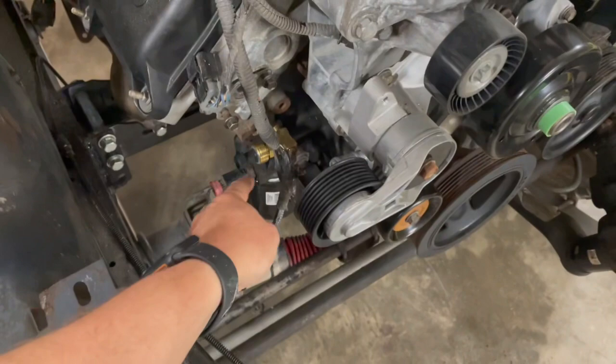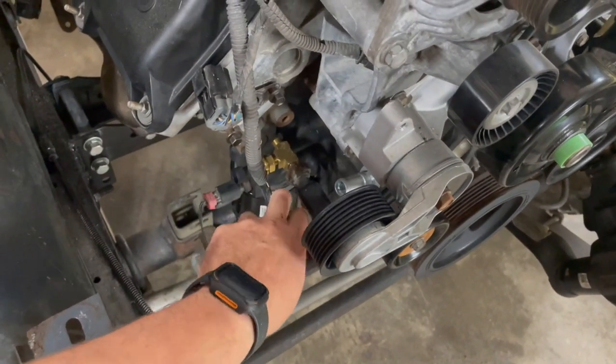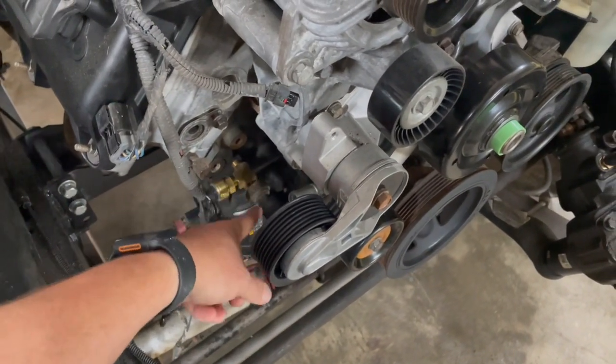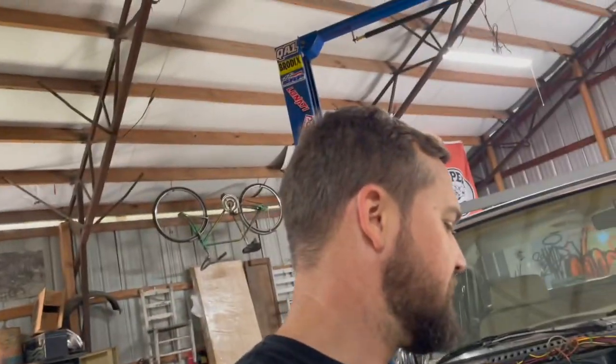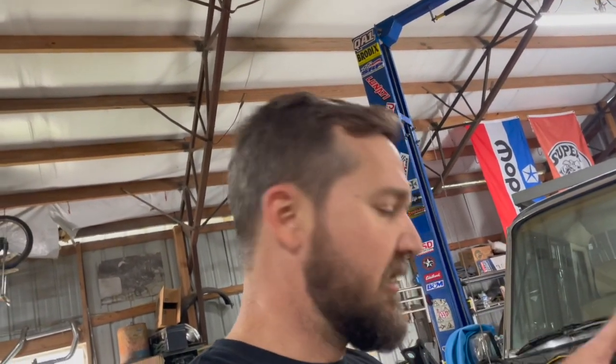So the other day, I didn't film this, but I got my oil pressure for the Dakota Digital mounted, and the factory is still there. We just went and got a 1/8 inch T, and screwed it into where the original one went in, and that way I can have both of these sensors. I don't know if the ECM even needs to know what the oil pressure is, and I couldn't really find anybody say yes or no on that. So I just put a T in it, and they'll both be hooked up.